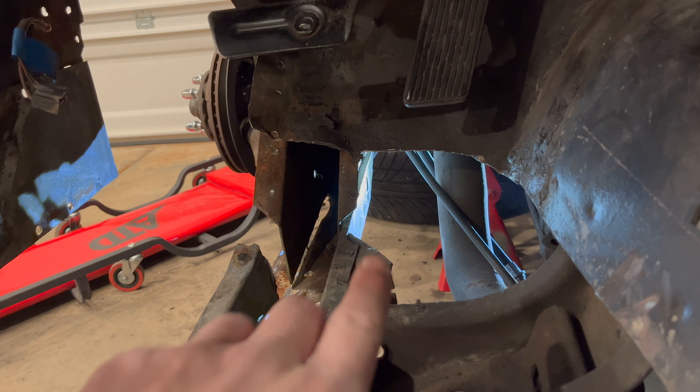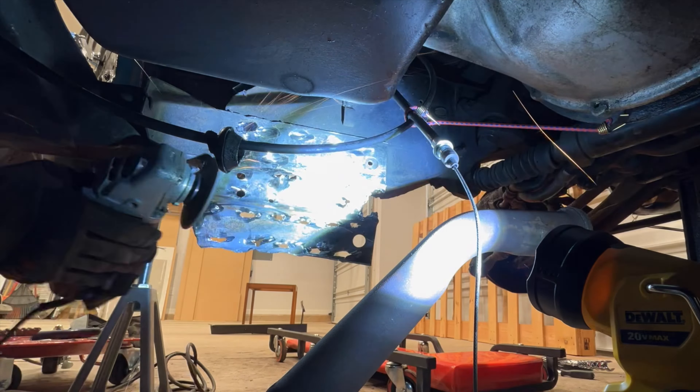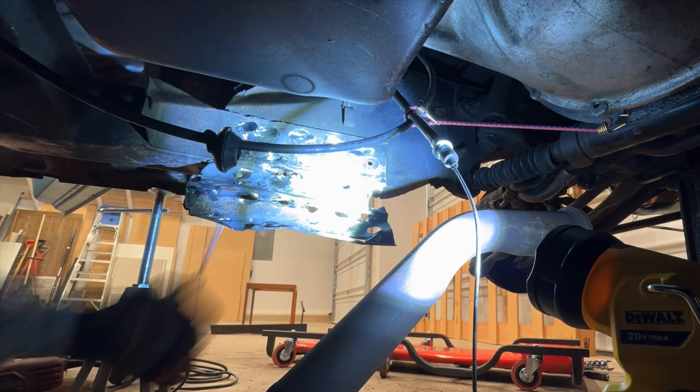The frame rail metal is good metal back there. I want to grind off as much as I can and weaken the top layer. It takes a little bit longer than just drilling out the spot welds, but it reduces damage from prying or grinding through into the parent metal underneath.